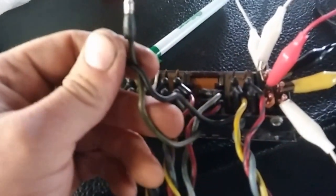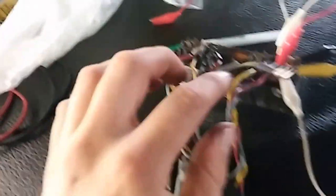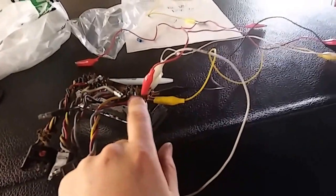So that's where I'm at. I gotta do all these switches and I gotta wire all the pigtails in. A couple of the wires, the way they did it, on two of the switches right here, they have the ground leads. Like, I have to wire those in. I don't know why they did it that way, instead of being in a nice pigtail. But I'm gonna leave these pigtails and cut this end off, and I don't know if I'm gonna add wire. I think I'll add some wire and then make it a little easier, and I'll solder those and then do some nice connectors up here. I gotta find something that'll fit these pins nicely, and I'll make some nice connectors for that.